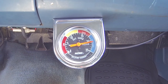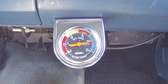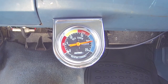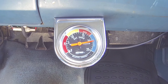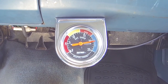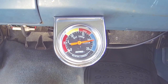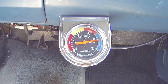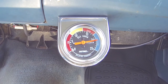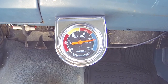We also have a big one of these in the Studebaker — that was more of a floor-mounted one. This is an underdash one, but I really rely on it a lot, like when in the cold, when this car isn't quite as happy. I'm talking like in the middle of winter, it has to warm up more. This gauge gets a little funky and you can see it kind of dropping into the 15 or even to the 12 range. And if you leave it and don't do something about it, it'll stall. So yeah, for Gearhead there, I thought I'd shown that.